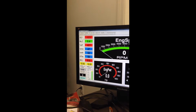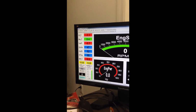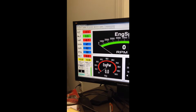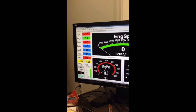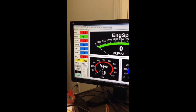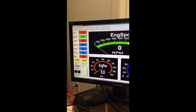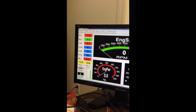Right here is your air-fuel ratio in the left side and the right side of the engine. This would constitute only one bank left and one bank right, this wouldn't do all 8 that we have the capabilities of doing. This is a blow-by meter. This would show you how much blow-by you have coming through the engine. On a worn-out engine, it would show if the engine needs a rebuild as far as the rings are concerned. It also would show if a ring package or a piston skirt design or a bore finish is better or worse as you do different types of finishes.